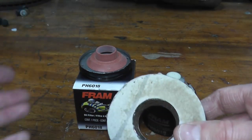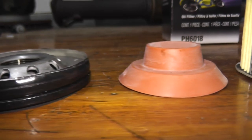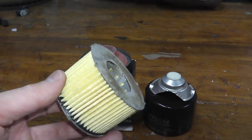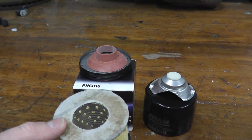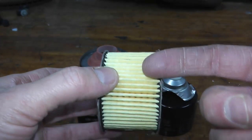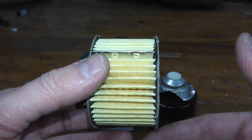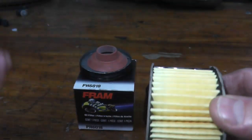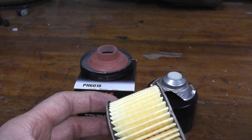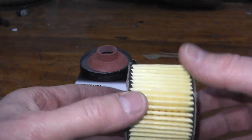I will say this — we have a separate video of opening up a Fram Extra Guard, and after 6,000 miles the end caps were in perfectly good shape. They were not brittle, not falling apart, not ripping apart. These companies typically outsource their testing, and I have to imagine Fram has done their homework on those end caps. I used to run Fram on my own vehicle, which went well over 250,000 miles running only Fram oil filters, changing the oil every 3,000 miles, and I never had a problem. The media itself has a 96% efficiency rating, most likely filtering between 20 and 25 microns, and the media is not synthetic — most likely a blend of polyester or cellulose, possibly enhanced. My recommendation: just follow what your manufacturer states for your bike, and you'll be perfectly okay.